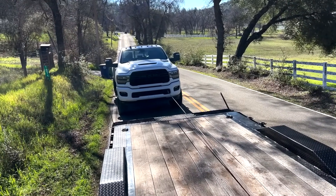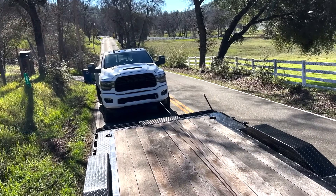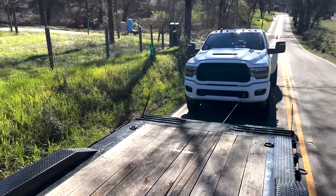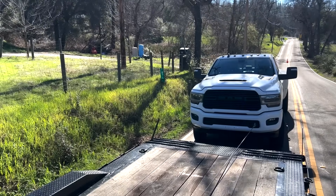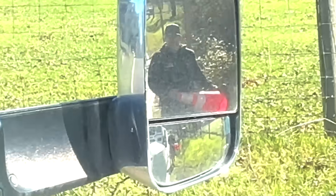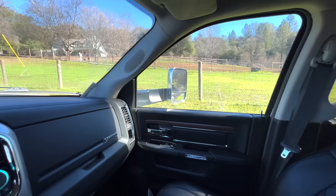I've got a 12,000-pound winch, arguably pulling it uphill and then up the ramps of the trailer — not the most mellow ramps. Probably could have thrown a snatch block in; a little pulley would have helped out a bunch. But we got it loaded, got it out of the way, and went down the street so we could chain it down.